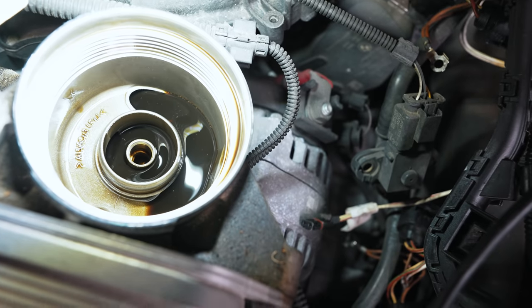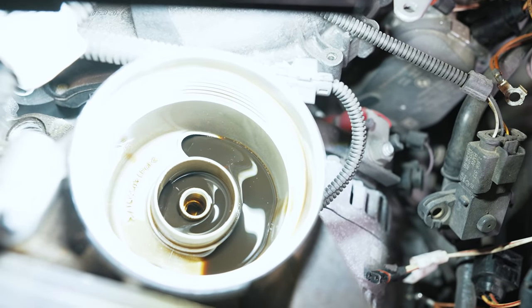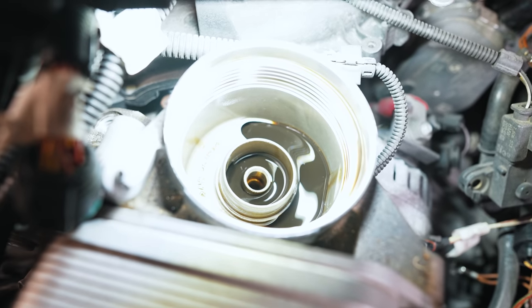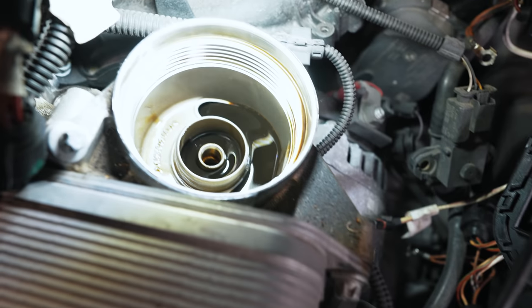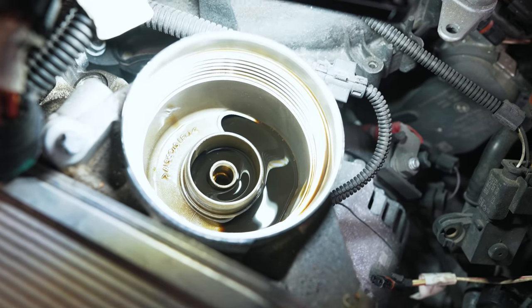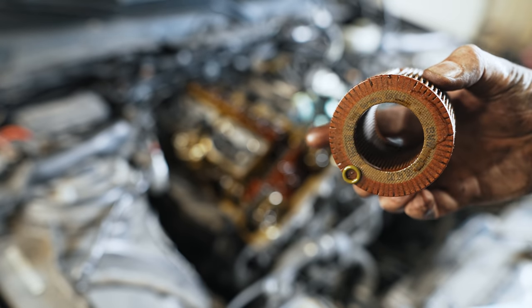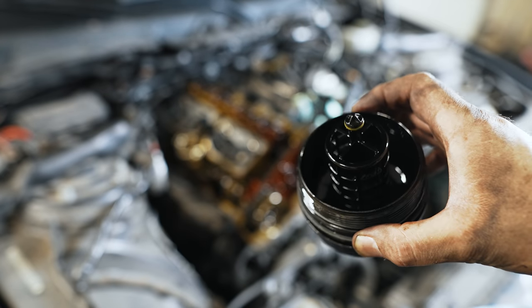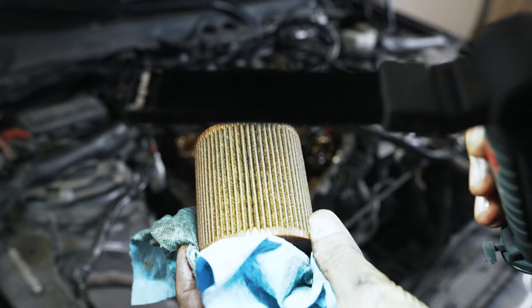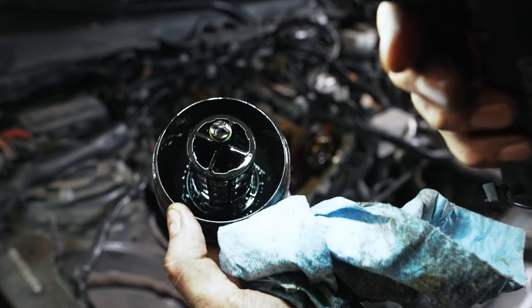Let's take a look at the oil filter. Looking inside there, I don't see any flakes at all — you just see some bubbles that are evaporating. Definitely not what you'd be seeing if there was catastrophic engine failure, which is a good sign. It's probably just restricted oil pressure. Maybe we're going to find some bits of timing chain guide in the oil pickup. But they didn't drive very much. First thing I would check if you have this sound is do you have shavings? Because you may spin a bearing. The last oil change was done at the dealer because they did the oil pan gasket. But look at that — there's an O-ring just sitting on the filter. They put a new one but probably let that fall in there by accident. Zero metallic particles. Very good sign.